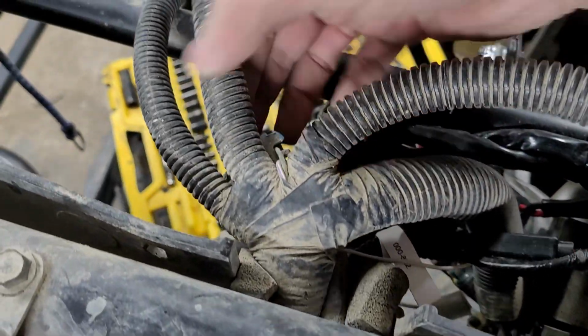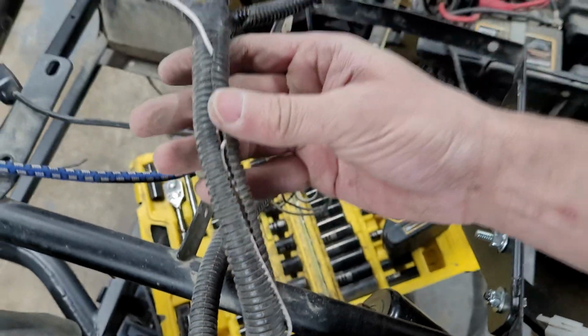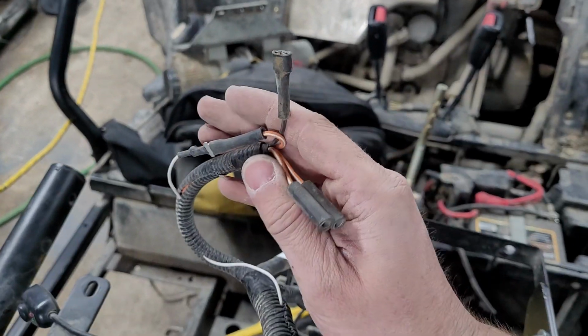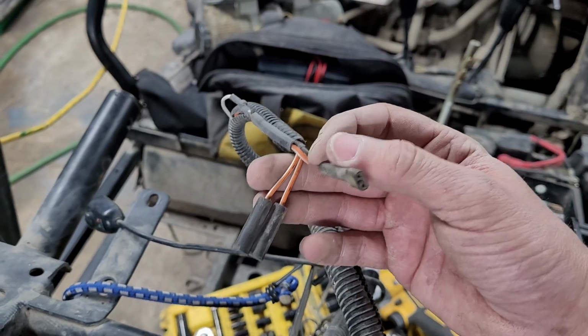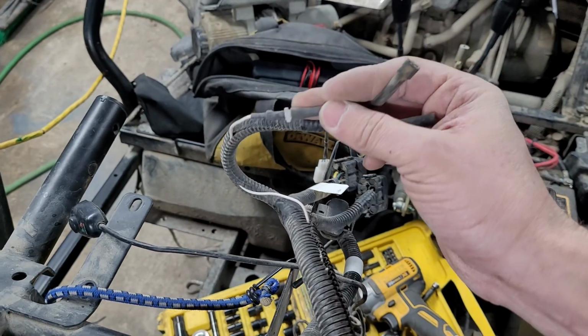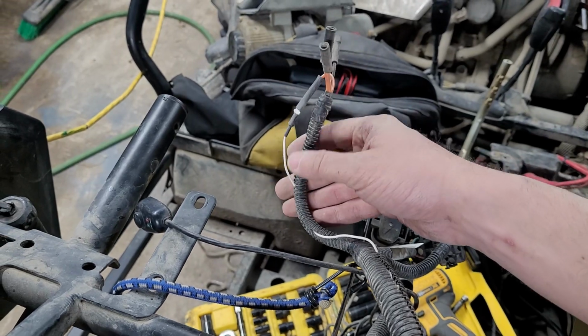Now I had a little bit of confusion with the remote wire for this thing, as it was specifically saying that it was a yellow stripe wire, but this remote wire basically just needs to turn on with the ignition. So what I did, a little different, is I took my white wire here and ran it through. You can see it's right here, and I kind of wrapped it around, and then I tucked it in to this loom over here. It's a pain in the butt to do this, but I did it this way, going all the way to my auxiliary power that we have, because Polaris was kind enough to give us extras. One of these will go off to the 12 volts, like cigarette lighter looking plug that's on these things. So I modified the little spade connector that's on there and just hooked it up like so, tucking everything into the wire, and I will just electrical tape it all together so that way I don't have to worry about wire coming out. I feel like doing it this way will give me a cleaner install and just make everything look a little bit nicer and neater underneath the dash, because it's already a disaster wiring as it is.